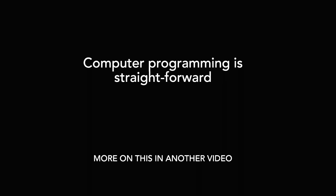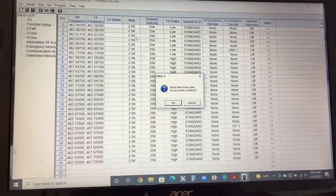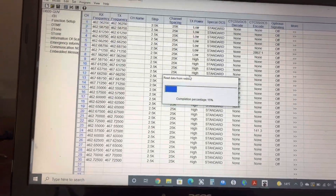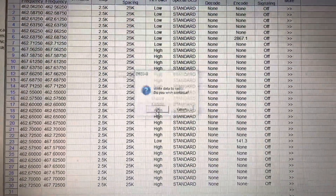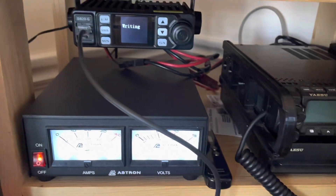I did want to show the computer programming software. It is pretty basic, but it works really well. I didn't have any glitches. I did manage to find a couple extra steps I needed to locate the comms ports. Go into Device Manager, locate your comm port, and then go up to the menu in the software and set the comm port. That's the one part that is missing from the instruction book, but they're going to fix that.